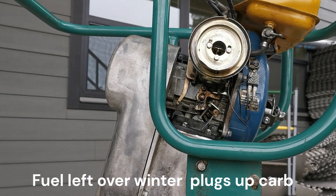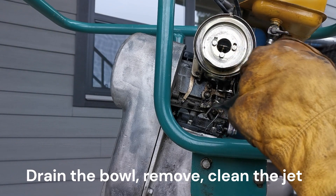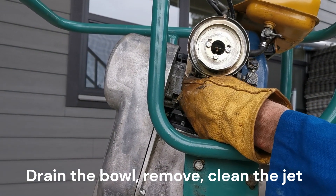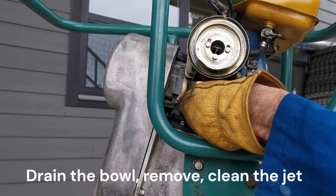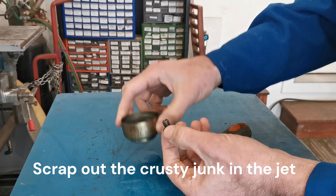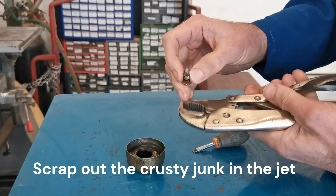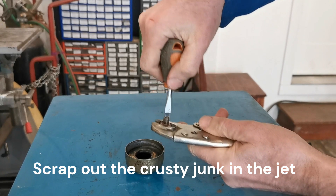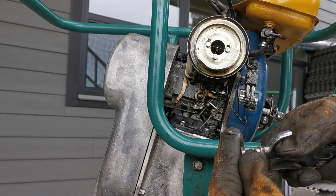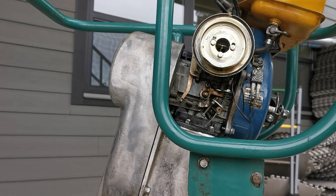It takes three screws if you want to take the rest off. There we go — fuel coming out. Bolt is loose so I can undo it underneath. Takes the float bowl off; at the same time you get access to the jet. There's the float bowl and there's the jet inside — it's very simple, it just sits there. The jet for metering the fuel is actually in the end of the screw here. So if you take the jet out, just hold the screw, take a screwdriver, take out the jet — or just blow it out. You can remove it. And voila.